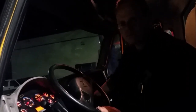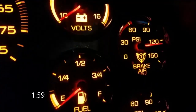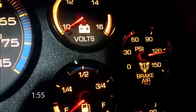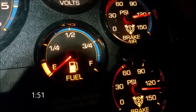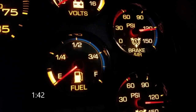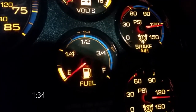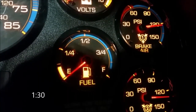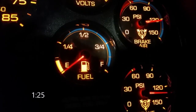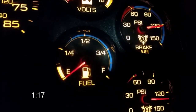We're going to turn off the vehicle and watch the drop — it should drop no more than four PSI. We're sitting at about 123 on the secondary, so it shouldn't drop below 119. Two minutes just watching it. What this tests is how well the system and supply tank and all fittings going back to the supply tank are holding up — checking the lines, safety valves, and service relays. All those pieces that charge the system is what we're really checking, making sure there's no major leaks.